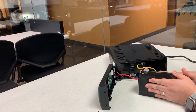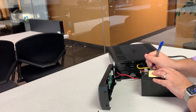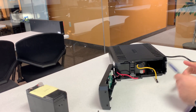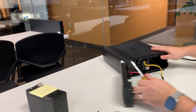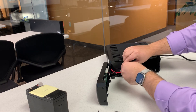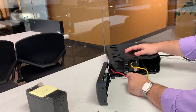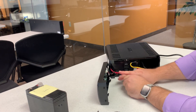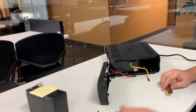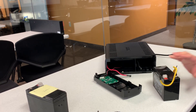The bottom battery unplugged really fast, which is good. It's something you might want to do first if you haven't done this very often. I like to just make a note — yellow, black — and label this as the bottom battery, that way when you go to replace it you know what to do. On the other side there's a bracket that we're just going to unscrew. It's just helpful knowing which is which. Bracket's almost off — set that there and make sure you put the screws in a good spot. This one pulls right out; it's exactly the same as the other one.